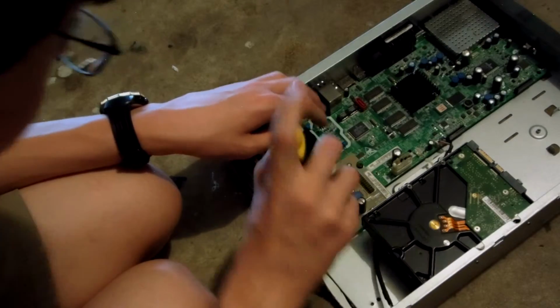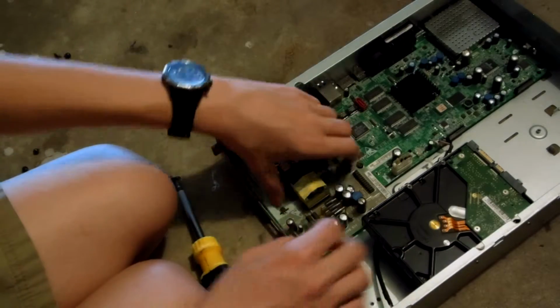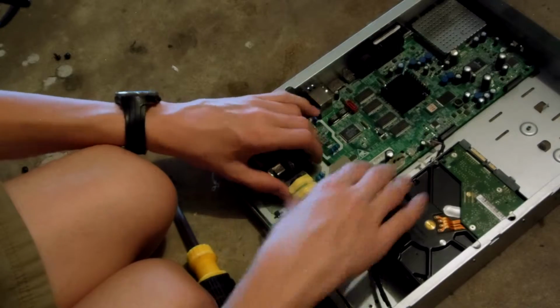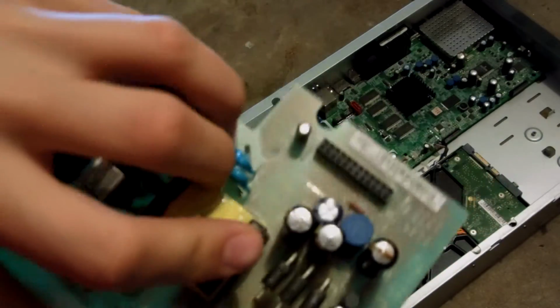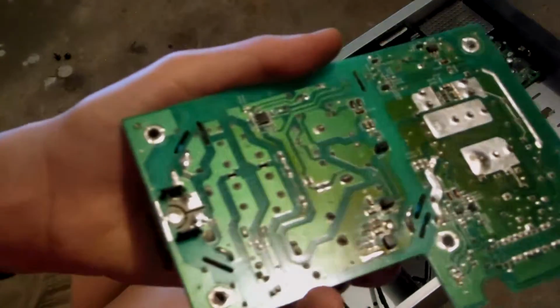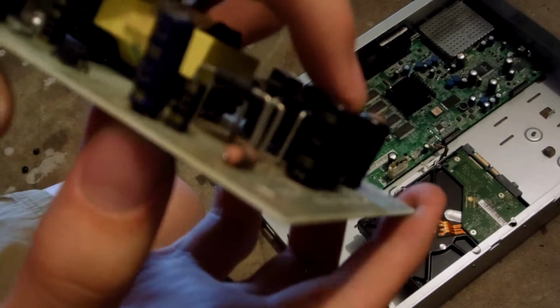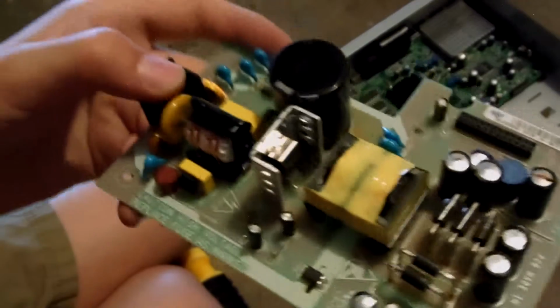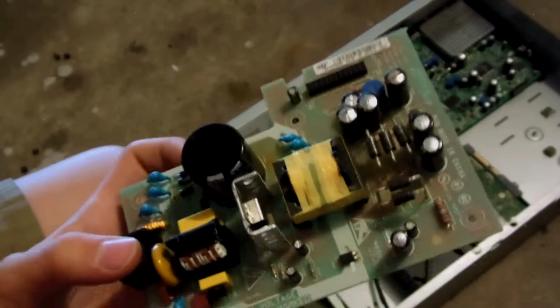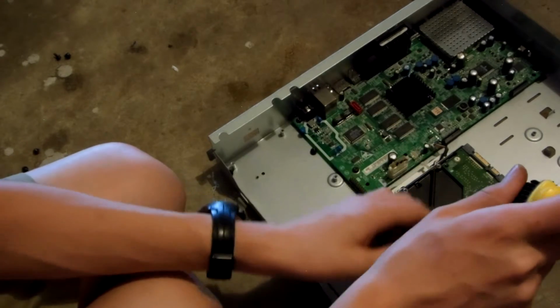So I am removing the power supply board. What the? Oh, connector's stuck. Yeah, connector. Right there. Pins went right through that. But yeah. You can tell the capacitors are bulging. You can just tell that one leaked its fluid. See, a lot of these are busted. So these are very low reliability capacitors on this board. Cheap little OST capacitors, so they're obviously China made. Anyway, they make good stuff, so they're not all bad.